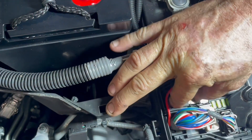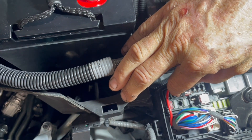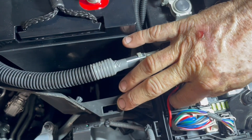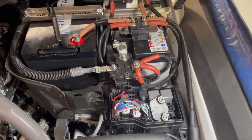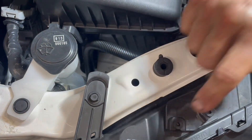It actually plugs into the third from the left as you're looking from the front. It's a 7.5 amp fuse — you take that fuse out and replace it with the fuse tap. That gives you your ignition source and provides the fuse for what's original. That's the cover, which can then go back over that, so you can clip that cover back on when it's done.